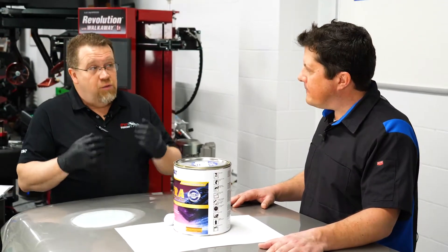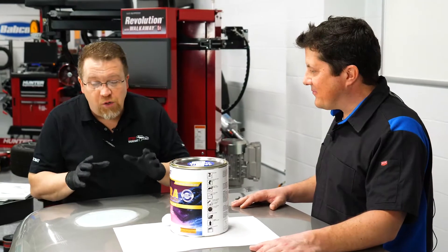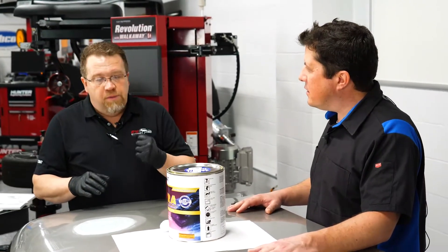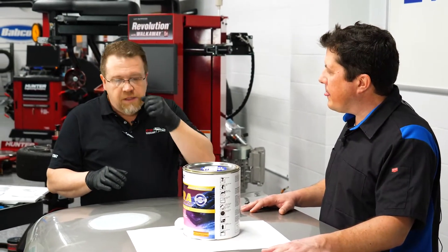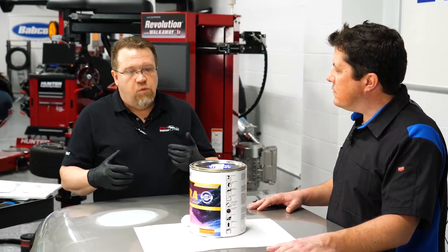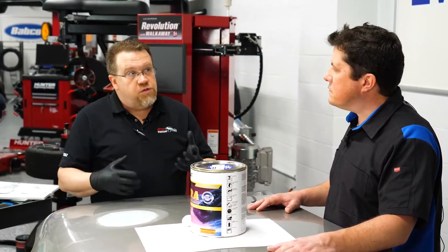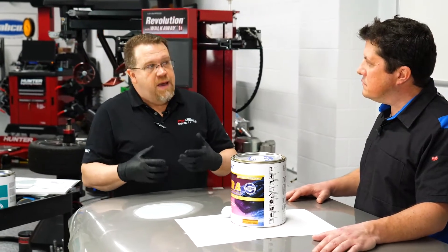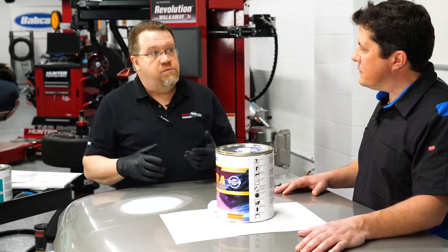But micro pinholes — well, I'm getting older, these are bifocals — if I have to get really close and look very carefully for them, those are the micro pinholes. Micro pinholes are just pinholes; they're just really small. A lot of times, what we've seen over the years, as the chemistries have changed for the primers — we're starting to see more ultra high solid, low VOC primers — all these materials are starting to change chemically because of the solvents in them. Years back they would fill in those micro pinholes, but nowadays they don't quite fill in as much.